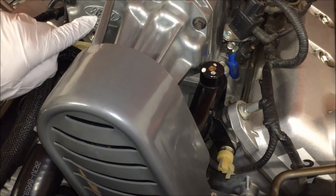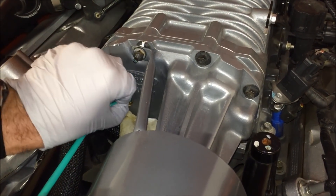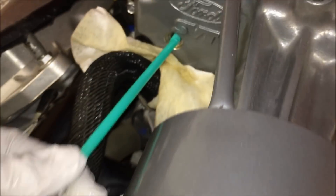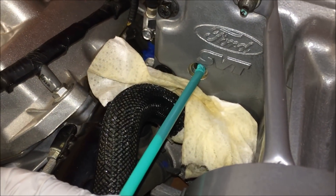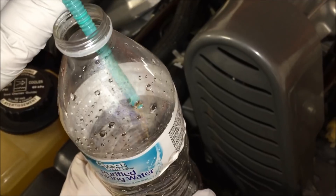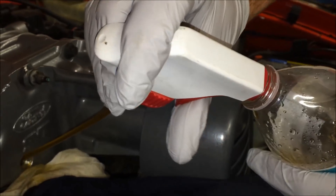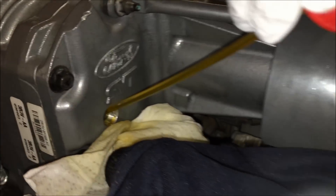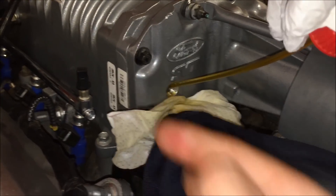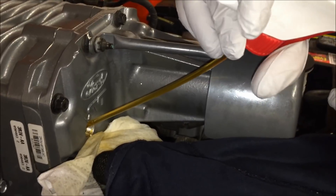The straw just has to fit down into the hole. When it goes in you'll hit a wall straight on, so you've got to go in and then angle straight down. Feed the straw in and downward. As you draw the syringe backward you'll be able to siphon the fluid out, draining it into a bottle. Another faster technique is to use a spray bottle — just put the hose in, access it from the side, and spray all the oil out.